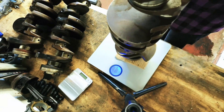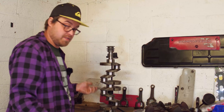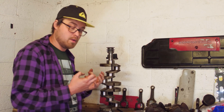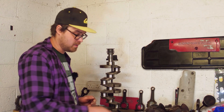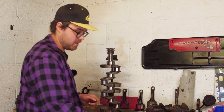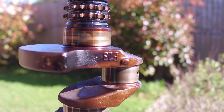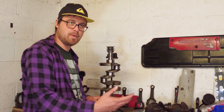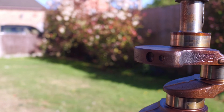The OM601 crankshaft comes in at 17.9 kilograms, which is what we'd expect — diesel crankshafts are typically heavier because diesel engines use heavier connecting rods. The two M111 cranks are near enough the same crankshaft. One noticeable difference is that on the 983 the markings protrude outward, whereas on the older 975 everything is embossed into it.